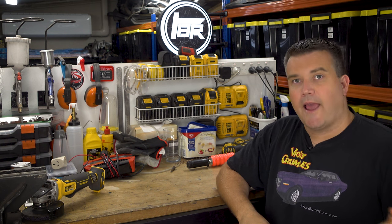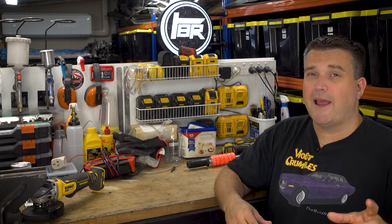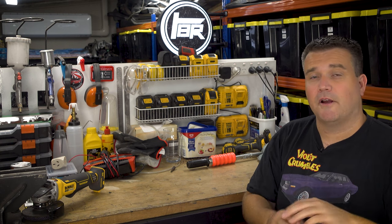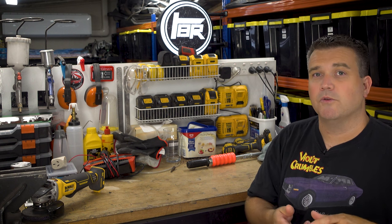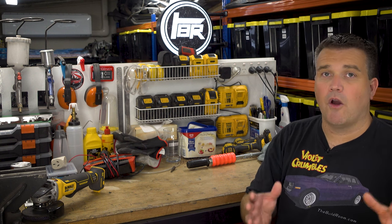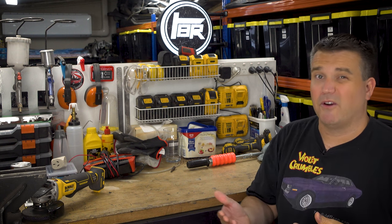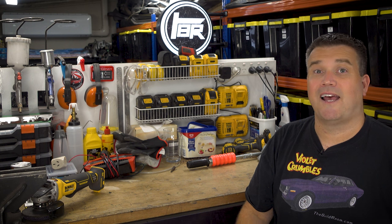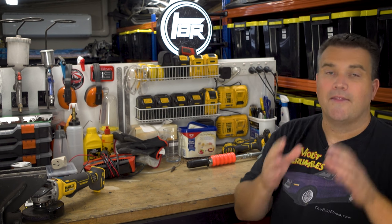Overall, I am really happy with the progress and the outcomes that we made today. In terms of the dent puller itself, overall pretty happy, but there are a few caveats that you should know. First and foremost is that issue that I was having with the power. So don't expect this to be an easy thing just to throw on a normal circuit at home. These are more industrially geared units. I mean, mine could still potentially have a fault in the unit, which was causing my problems, and we found a workaround, but I don't think that's the case. It's not showing any other weird behaviors. So I'd say it's just that quick initial ramp up, or the curve needed on the circuit. So that is something to consider.